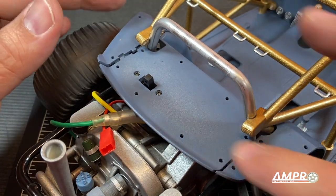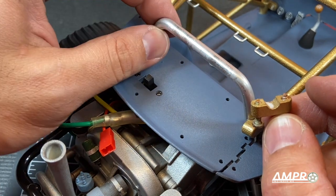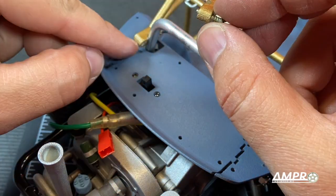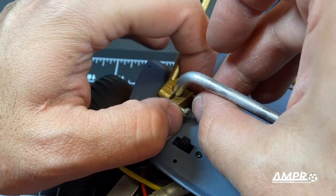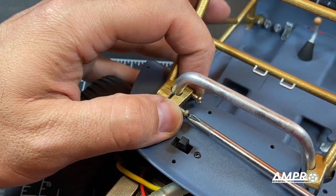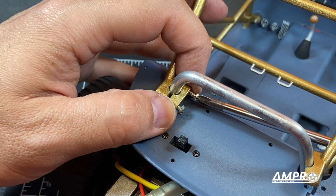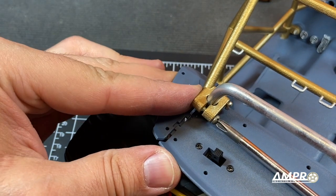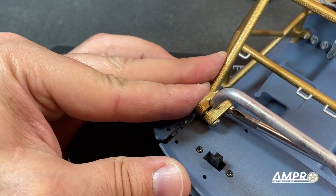All four of these screws have been installed. So these parts here will be lined up when we put the rear deck on, so don't worry about these too much. Next, we're going to install the little retainer which clamps the cage onto the transmission hoop. For these, I would highly recommend you use some self-tapping three millimeter diameter screws — just use a 2.5 millimeter drill bit to make sure that is cleared out and you'll be good to go. So just go ahead and align that puppy like this. The longer the screwdriver, the better, and it'll just seat itself very nicely. Nylon is incredibly strong, so as I've mentioned probably 30 million times in my videos, the moment this stops, it's done — there's no reason to over-torque and strip these holes out.